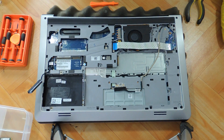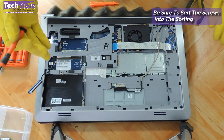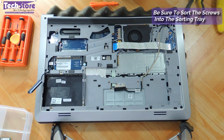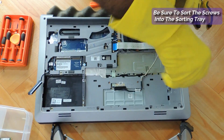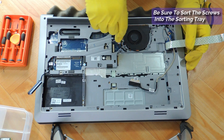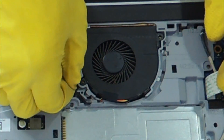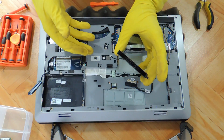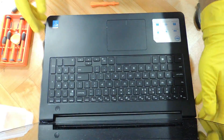The strip connector is to be removed. Now let's start removing all the visible screws because the base of this particular laptop will come off — we have to remove all the screws. Then we need to remove the fan. The fan is off. Anybody wanting to replace the CPU fan can do it. Now we need to flip it up to remove the keyboard.